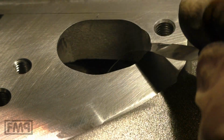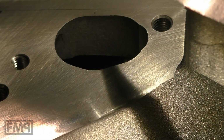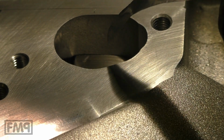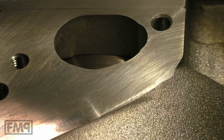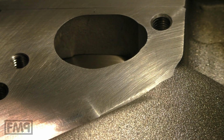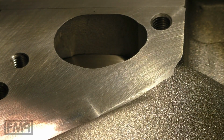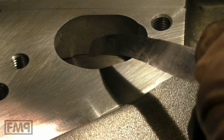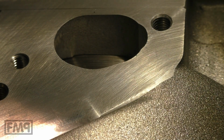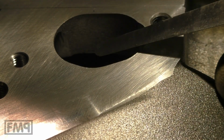Engine case, crankshaft. These two parts are defining the rotary valve, a valve that is supposed to close and open in this direction, open and close the intake, and this needs the tolerance clearance of 0.05, 0.2.